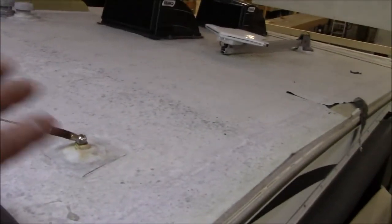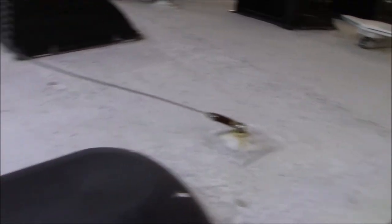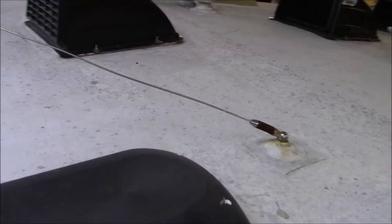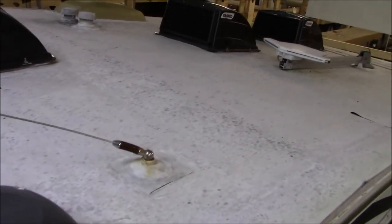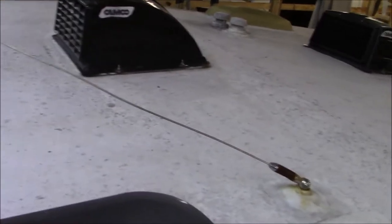That's why I'm not a proponent for coating systems. On something like this you probably want to tear it off, see what's going on, and then put a good roof on it. You don't want to cover up something when you don't know what's underneath - especially on something this expensive to put on. There's a lot of labor involved, so why would you want to do it again and find underlying issues that weren't addressed when the roof was open?